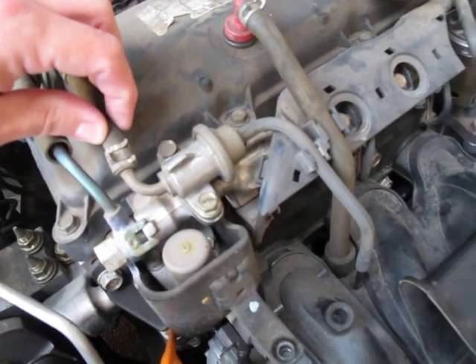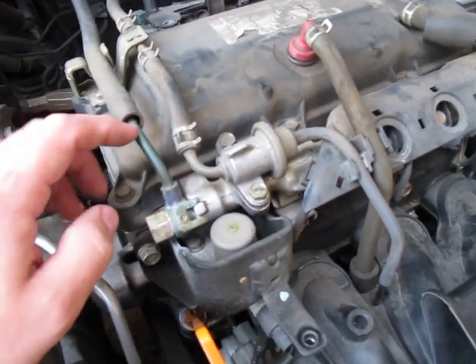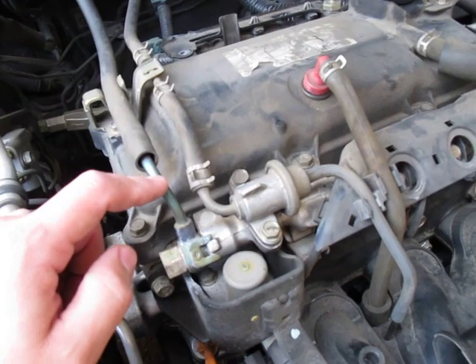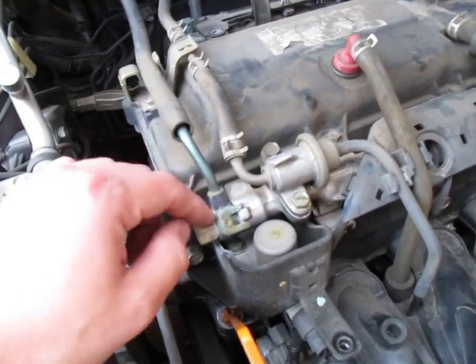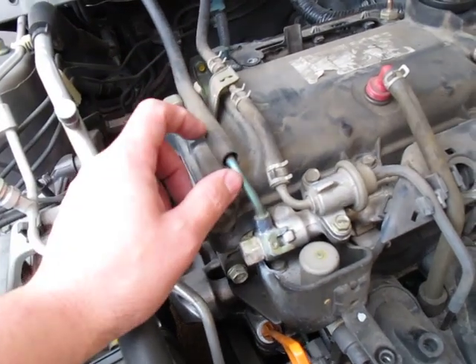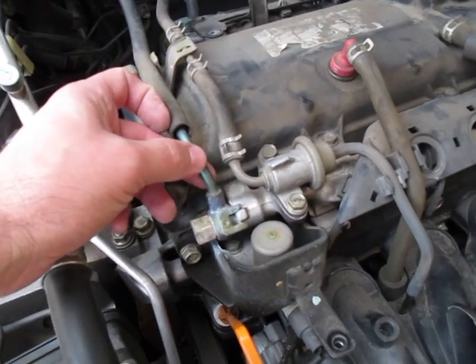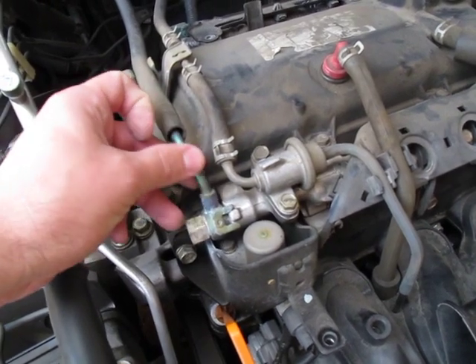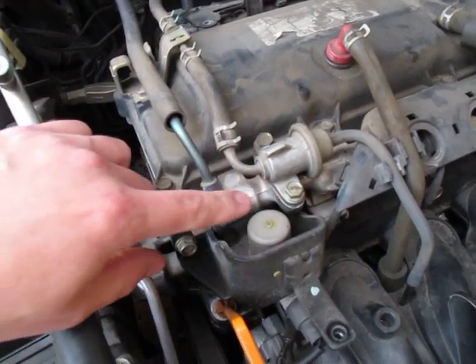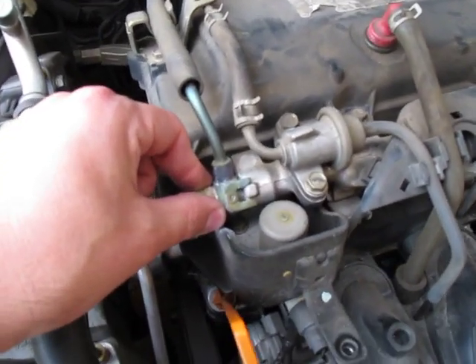I'm going to cap off the vacuum here and here so that the vapor fuel does not get returned to the gas tank, because then it would just cool off on the way back to the tank and turn back into liquid - we don't want that. I've read that vaporized fuel is actually very cold - a very cold fog. I thought the gas would have been hot coming in having just been vaporized, but once gasoline has been vaporized it's a very cold fog. I might even get icicles on here - that's what people are saying is happening to their systems.